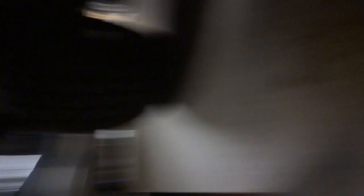Either way, this is what I ended up discovering: underneath the back of this truck, down low, tracing these wires — there is a place right here. You want to pull those off and check for corrosion. As you can see, it's right by the spare tire, here's the back bumper. Getting underneath near the spare tire, where those things plug in, I had a fair amount of corrosion.